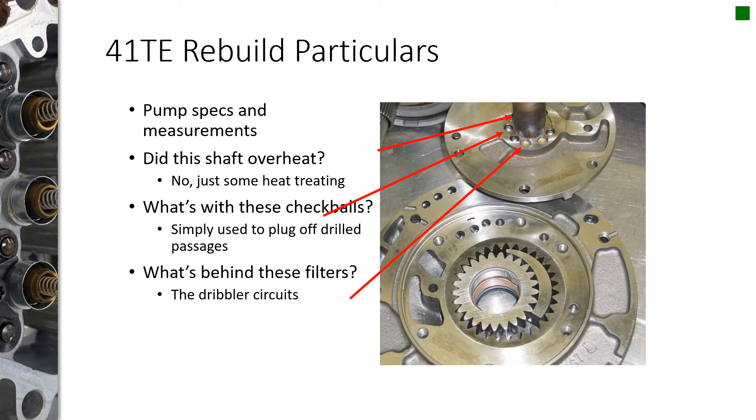You can also use a flat bar sitting in there and try to slide a feeler gauge underneath it. The problem is it's usually less than a thousandths of an inch, and your feeler gauges usually start at one and a half thousandths — that's the smallest you usually find.